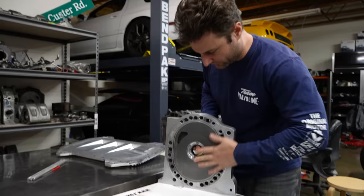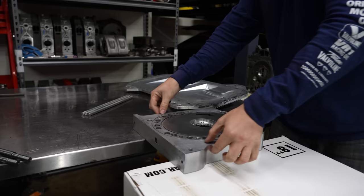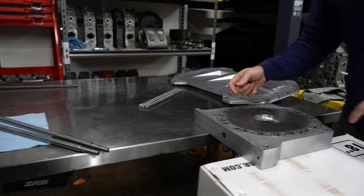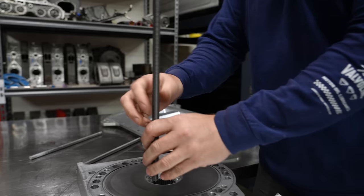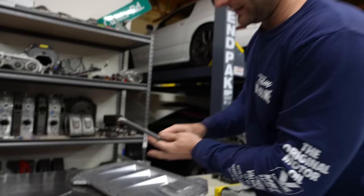Now, I've checked all these surfaces. Everything is flat. There's no burrs sticking up, nothing like that. We're actually going to be setting the motor with these edges held down, and the reason why is I'm going to be taking the two dowels and then these three custom length bolts I made, all thread. Those are gonna pin this half of the motor up once we build it all. We'll skewer it from the bottom, nice little pressure on there, and then flip the motor with the rest of the E-shaft upside down. It's a very cool, weird process.